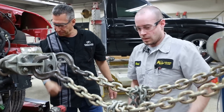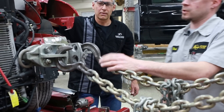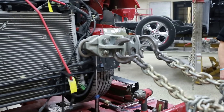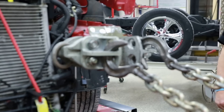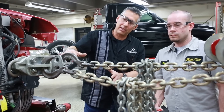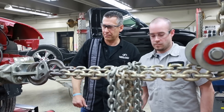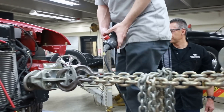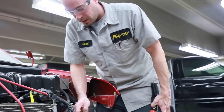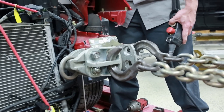Chad, please take over from here. I'm going to be using these towers here, which are capable of pulling 10,000 pounds apiece, to try to get this mash out on this left frame rail. We're going to be pulling at a constant level, straight out, to try to restore the height, length, and width of the rail. All I'm doing now is watching as I'm pulling, going slowly, to find out how the metal is going to react. Everything reacts differently — no two accidents are the same, and everything needs to be taken out with a different viewpoint.